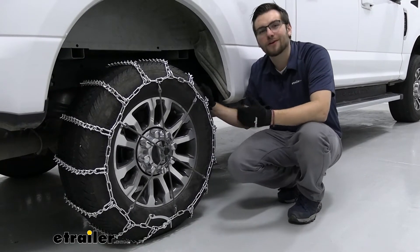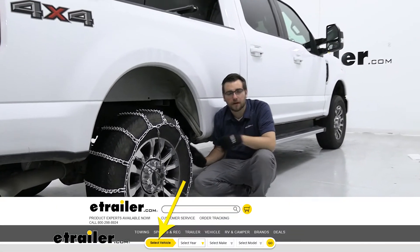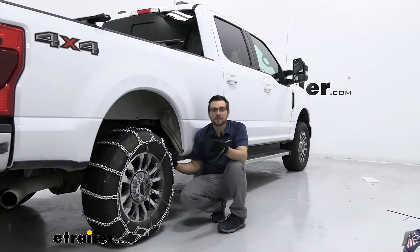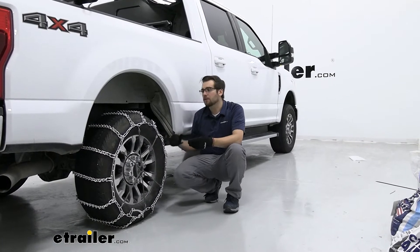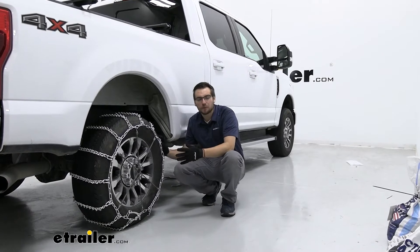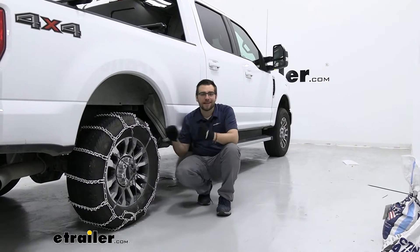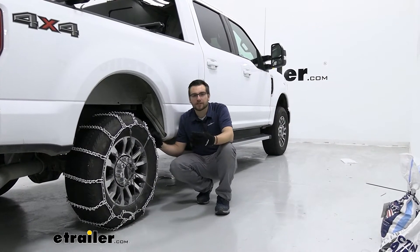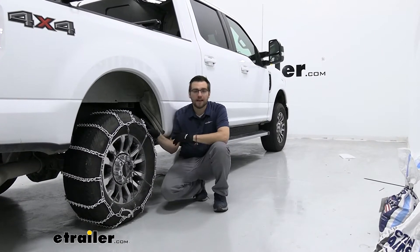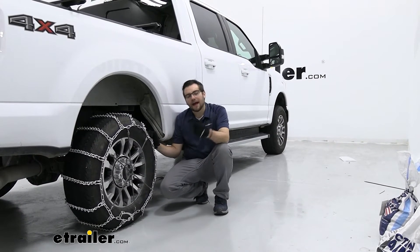There are a couple of caveats before we get to our installation. The big thing is making sure we have the right tire size for these chains — so let's put our tire size into the fit guide at eTrailer.com to get the right fit. The other thing is where to actually place these on our vehicle. Today we have them on the rear, since a lot of us like to load up sandbags and gain traction in the back. However, you do have a lot of weight in the cab and engine area, so those front wheels are definitely going to have traction too. If you want to be really safe, two sets of chains is excellent — one on the front and one on the rear.